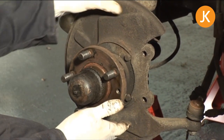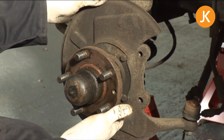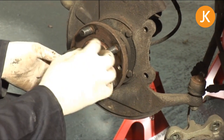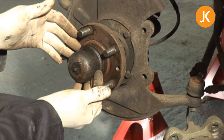It's a good idea at this stage to give the backing plate a good cleaning and inspection. If you need to, you can fit brand new ones from JustCampers. Your wheel bearings — the outers and the inners — are just in here. It's a simple case of removing the speedo retaining clip and taking the dust cover off.